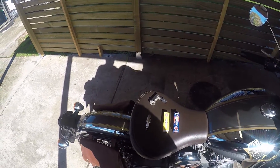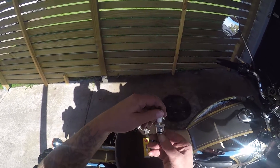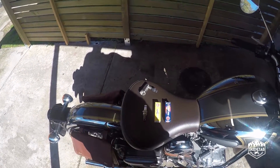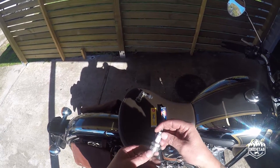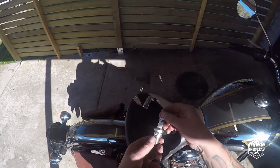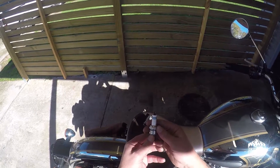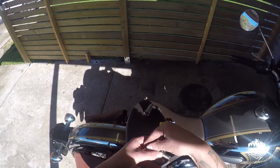This is a video about spark plugs — a good, better, best comparison. Doug comes standard with a Bosch WR7 DDC4 plug made in India. These plugs are renowned to cause issues in the international market. It's probably meeting a price point supporting the domestic market, but I cannot recommend enough to ditch that plug. In my experience it causes rough idling, hesitation, stuttering, and when you pull them after riding around town the plug is sooty — it's the wrong colour.